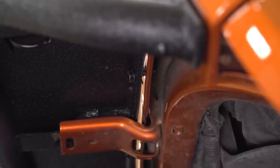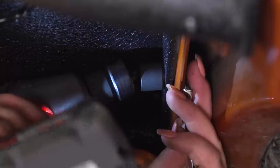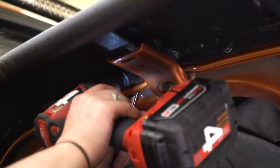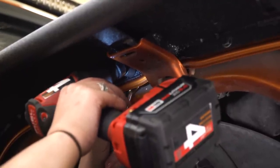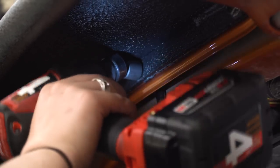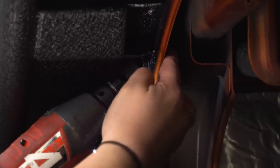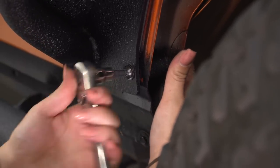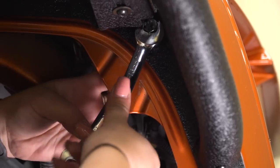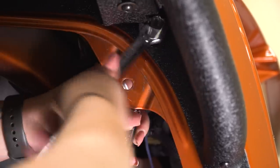You're not gonna have much room to work with, or you could use a 13-millimeter socket and a ratchet. I'd recommend holding up on the fender while you're tightening everything down so it sits in place correctly. Now take a 3/16-inch Allen key and tighten down our bottom two bolts. Then take a 13-millimeter box wrench and a 13-millimeter ratcheting wrench, since there isn't a lot of room up here, and tighten down this last front bolt.